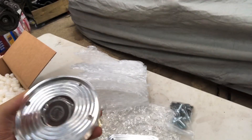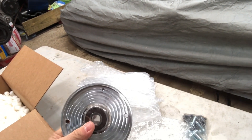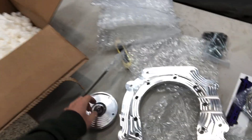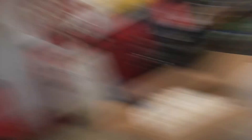This is the adapter along with the oversized pilot bushing that goes onto the transmission as well. With our Gen 5 motor we need to have the oversized pilot bearing, which is the same kind used on an LS7. Hopefully all this works. We'll come back and give you guys more updates once we actually start pulling the motor out of the Solstice, get the bell housing put on, get this FabBot adapter installed, and start putting it all together.